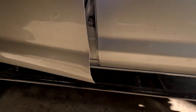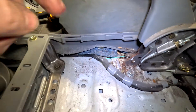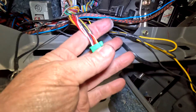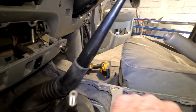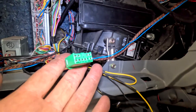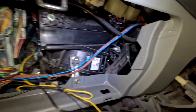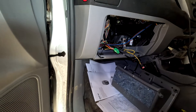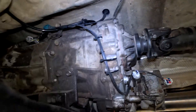I need to do some wiring. So this one, there's a hole drilled there — there will be a hole there soon. It's got a four-wheel drive computer, so that's going to be my power supplies and my four-wheel drive light. Same thing with the gearbox — drop a hole into it, drop the loom through there, run it through up. This one I power from here; the other one I actually powered by the back of the cigarette lighter and ran the wire up. Cigarette lighter is fused with a 15 amp fuse — pretty well perfect. My wiring is done on the second one. It actually took me more time to zip-tie it than to actually fit the wiring.